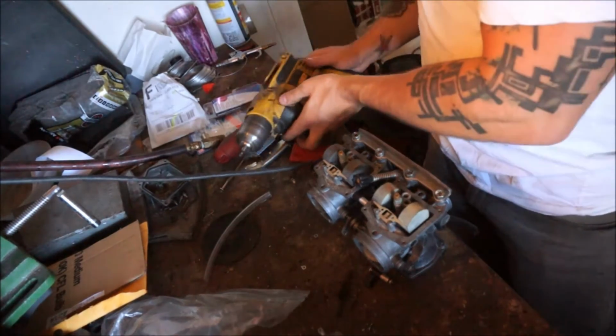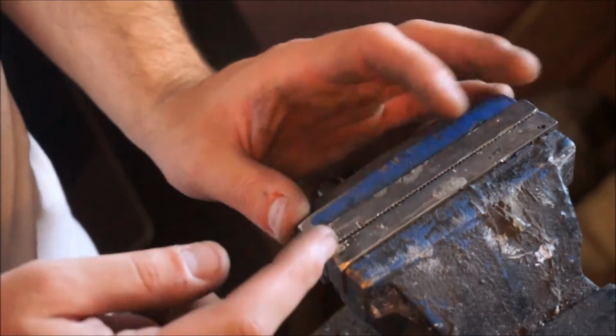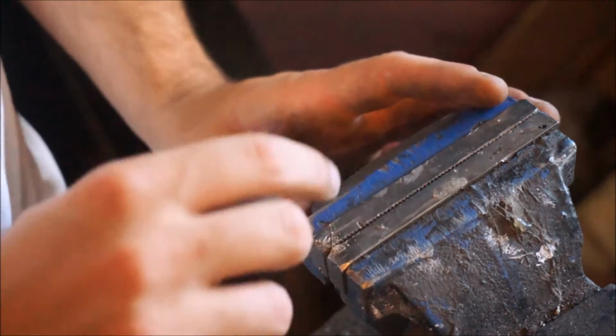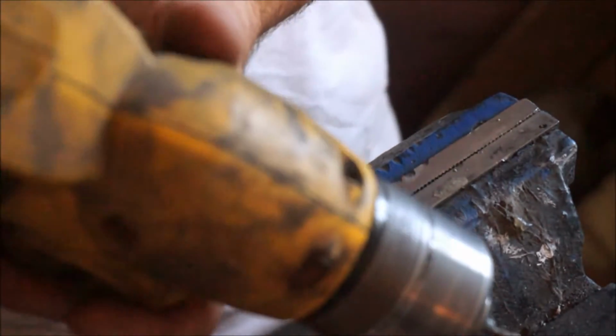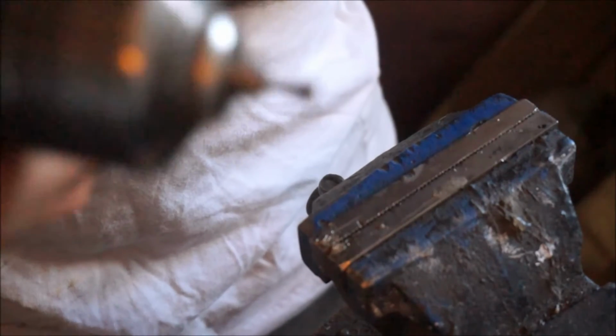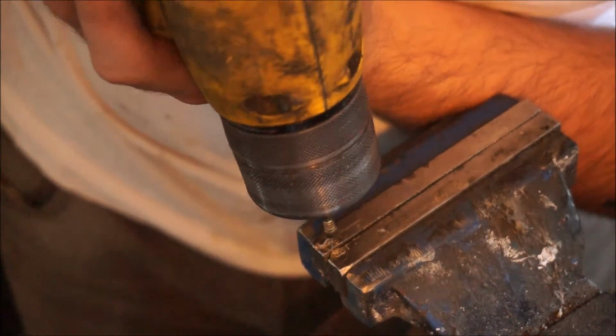And I have the other half of it. Oops, hang on, messy workshop. I have the drill bit right there. I only really have this much of it showing, because it's so tiny. I don't want any side-to-side force that might snap it. But this is brass, so I'm never gonna go that fast with it. Just go slow, find the hole, and let the drill do its work.